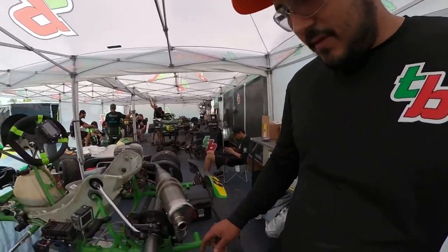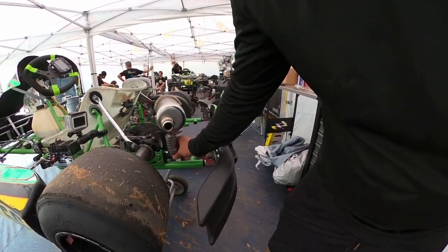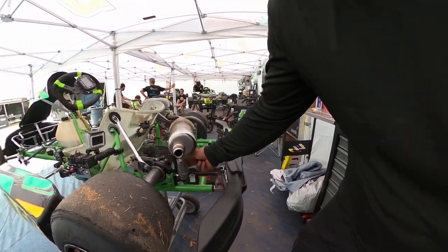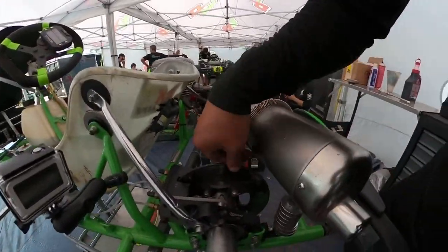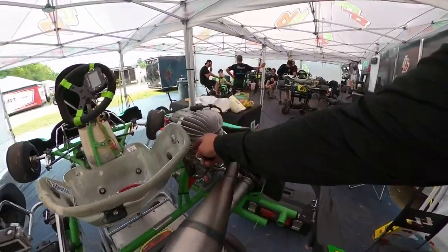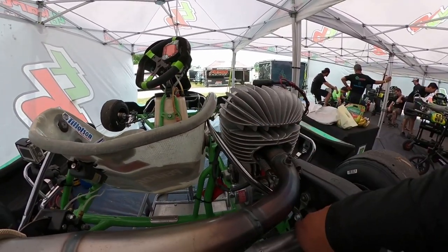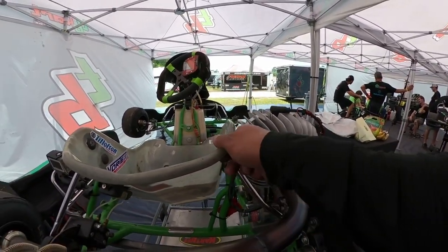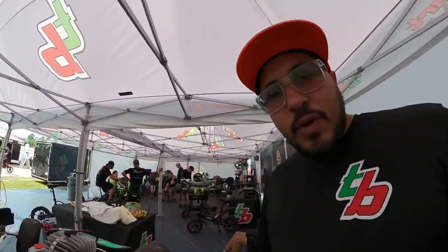So basically, grinding down this bolt, put a whole bunch of washers and stackers, seat spacers, exhaust is tight, clears the brake, and then we went under here and bent it down straight, adjusted here to here. So now we got two seat struts on the side. We got the wiring issue fixed. We'll fire it up. Ready to go.